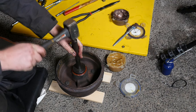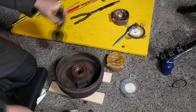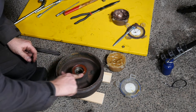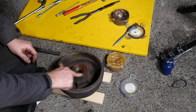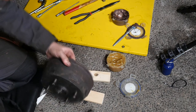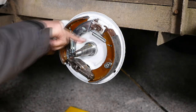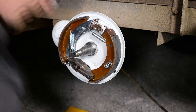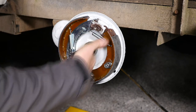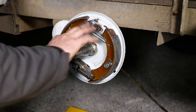Although the seal is damaged, hopefully this will hold the seal in place and keep some debris out. Make sure you don't get any grease on the inside of that drum, and if you do make sure you wipe it off. I'm also going to grease the stub axle now. That's all ready for the hub to go back onto — given that plenty of lithium grease there.